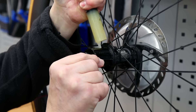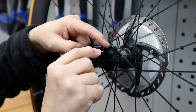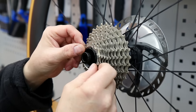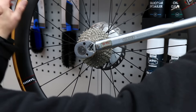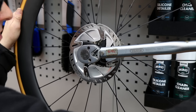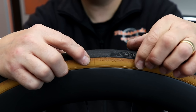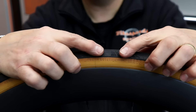So I'm putting a little bit of general purpose grease onto the cassette there, put that back on, and we'll torque that up to the correct torque setting - not over tightened as it was before. Someone must have used mega arms to do that before. Also just checking the torque setting on the disc itself. We often talk about this on our other videos - the rotation of a tire. You can see it here on this tire wall where it says rotation.